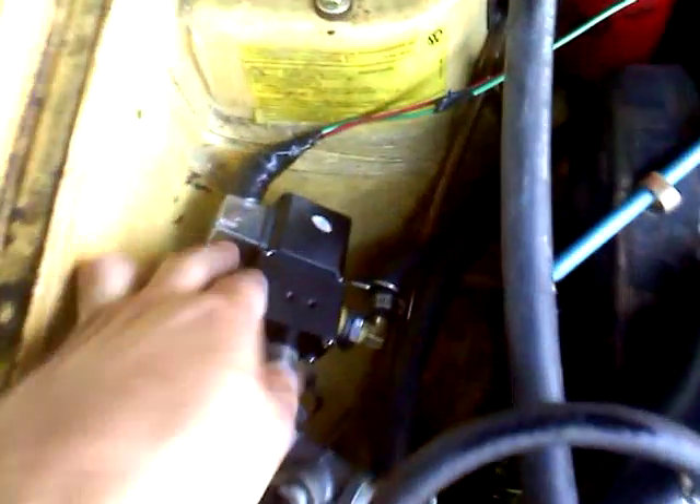The fuel return coming from here — I have a clear section of tubing on my kit so you can see if there's any air bubbles, and it loops right back in. It works fine as long as you don't have any air. If you've got an air leak, it's going to cause you problems because the air can't be purged out.